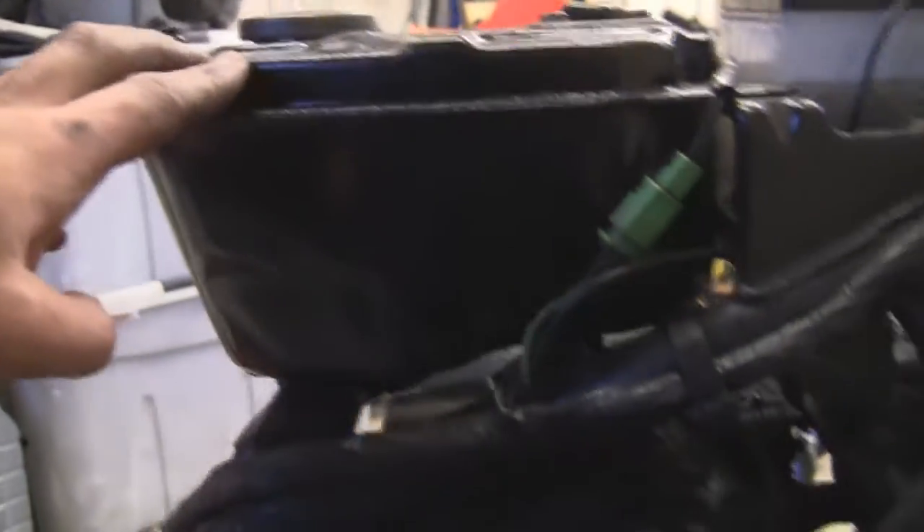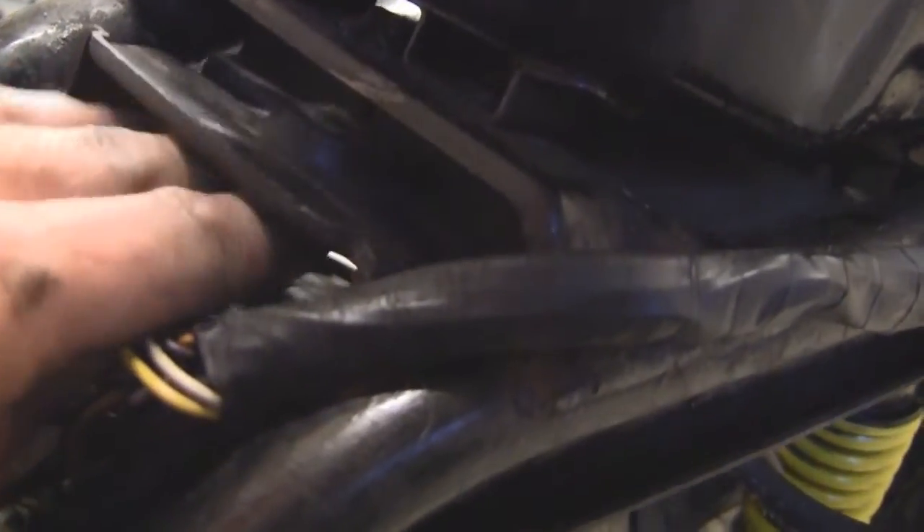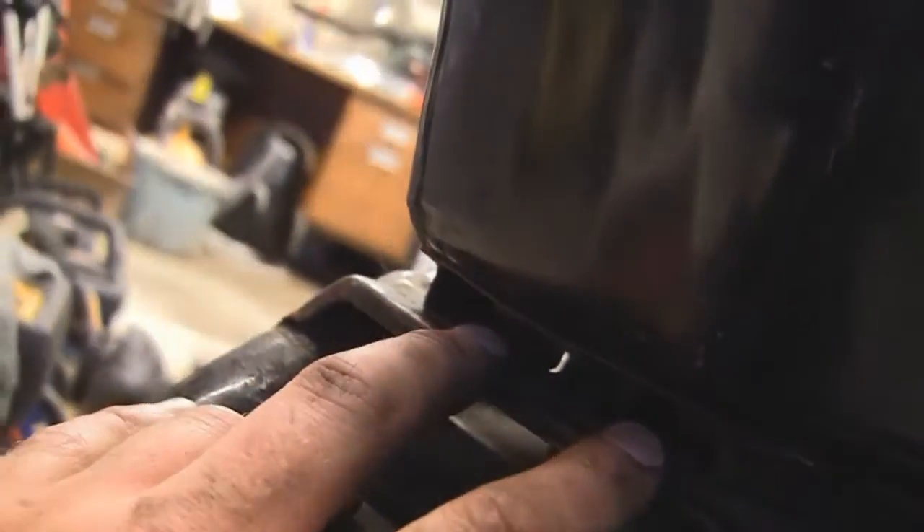So what I've decided to do is take this petrol tank off. To take the petrol tank off, one of these is basically a nut that sits on the underside of the tank, which is quite difficult to film. There's one that fits on here, and then at the bottom I've just taken that one off, and there are also two little nuts that you need to undo there. This plastic guard normally sits up there — once you undo the nut and pull it down it just moves out of the way so you can see a little bit better.